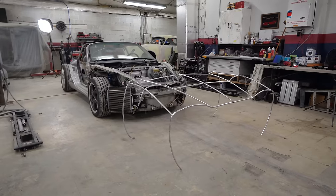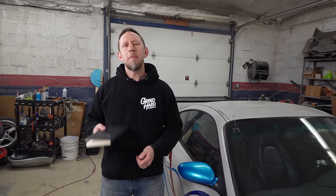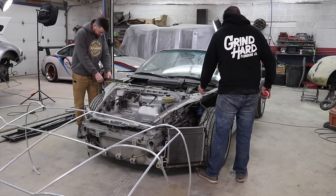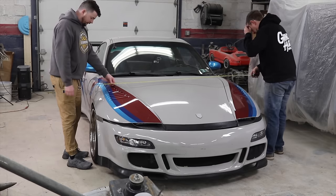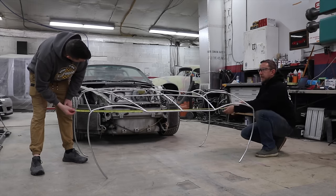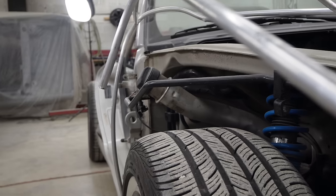Underneath it is a GT3 suspension, and that's the real reason we're bringing it into the shop. We compared a stock Boxster to the wheels and tires we had on here with our spacers — we were already 60 millimeters wider. Then we measured the fender lip on the slant nose and compared it to the fender lip on our new clamshell. The new clamshell is a total of 30 millimeters wider, which is only 15 millimeters more, and that works really well because we want a little extra clearance between the tire and the fender to get that 1960s vibe.